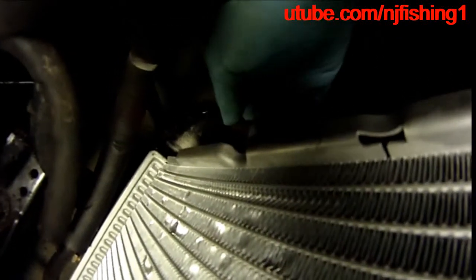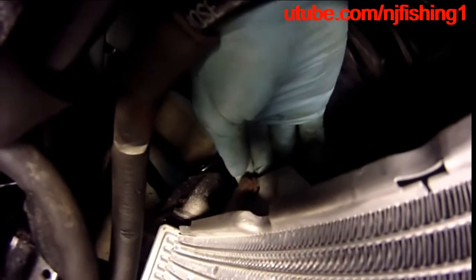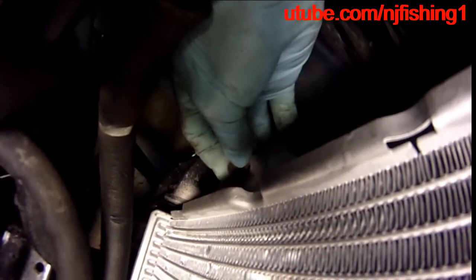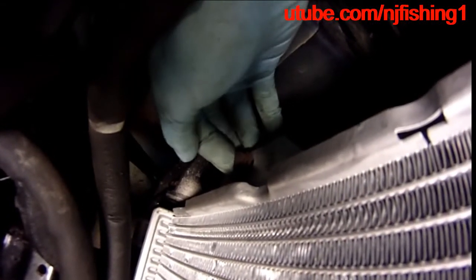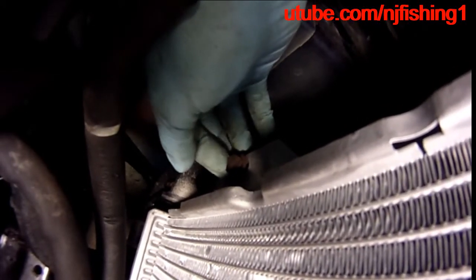And bolts, and I had to use both. I have to reach down and use both hands to be able to thread this bolt onto the fastener in the back, so I can lock the radiator with the back support frame in the back, so this radiator is not gonna move when the car is driving or going over bumps. There's another one on the other side, so I didn't tighten this down yet. I'm gonna install the other bolts, number 10 bolts, and then I will tighten both bolts after I'm done. Okay, so that's what I'm doing.